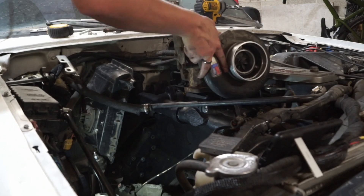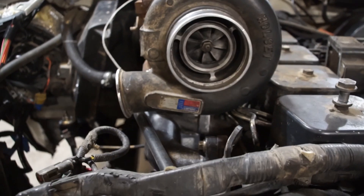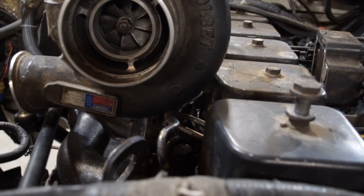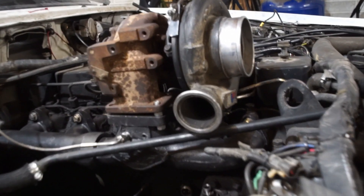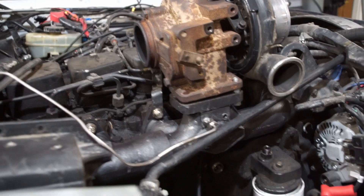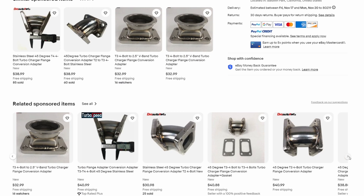There's another issue — it's also really close to the engine, almost touching the valve covers close. It's so close that the fuel lines are actually in the way. I could bend them out of the way, but it's still so close to the valve covers that if I ever went with a bigger turbo, it wouldn't fit. So this is an okay solution, but I need something better. I really liked it being on the front since it gave me tons of clearance, so I figured the easiest way to move this thing would be to just make a new turbo mount that moves it out and away from the engine. I looked all over for aftermarket turbo mount solutions, but unfortunately there just aren't any that provide the extreme amount of movement I need. That means I need to make my own — time to design a turbo mount.